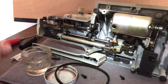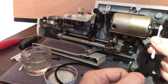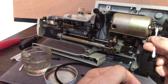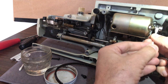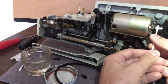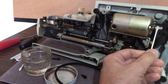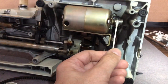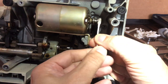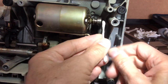I can start down here if I want — it doesn't matter whether you do the upper pulley or this one. Every sewing motor has a pulley that the motor belt is going to attach to and apply power through friction. I'm taking a cotton swab and dipping it in the alcohol. The reason I like cotton swabs is because, as long as you don't drench them, they hold the alcohol and generally don't create a mess.